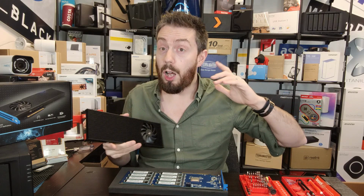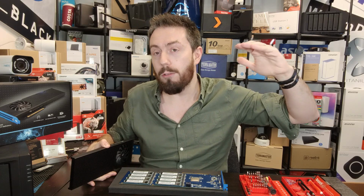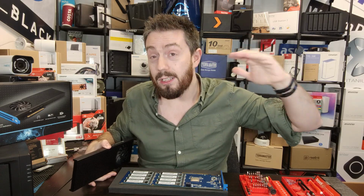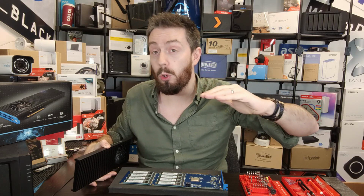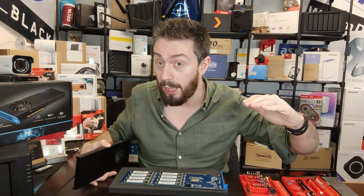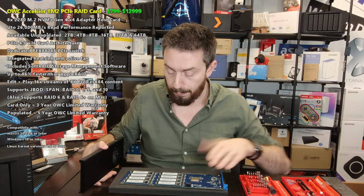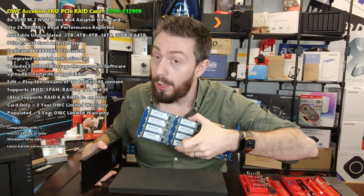capacities. I think the capacities are the right capacities, given that the highest capacity 64 TB in a RAID 0 is 8 times 8 TB storage. They've gone the right way, in my opinion, in terms of overall storage. The caps they've gone for, but the pricing seems a little askew, and I'd be very curious what the drives are in the 64 TB model, because these look like 2280 drives, what are the 8 TBs that they would use inside this drive? Do they use QLC or are they 3D TLC? But if I get an update on that one, I'll let you know in the software review.